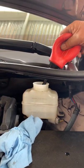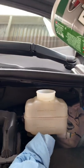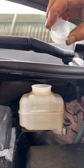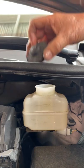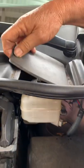Removing the brake fluid from your reservoir. Filling up my reservoir with some DOT3 brake fluid. Don't forget to put your screen, put your rubber cap, put this plastic cover on and you're good to go.